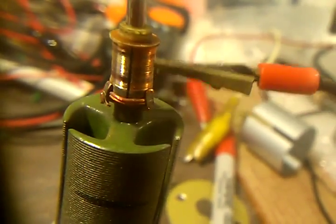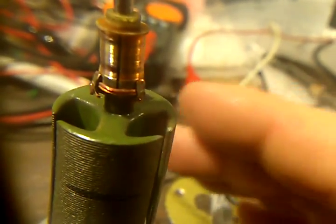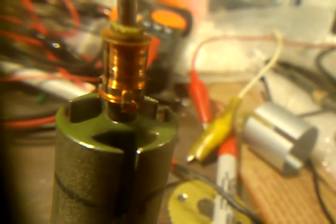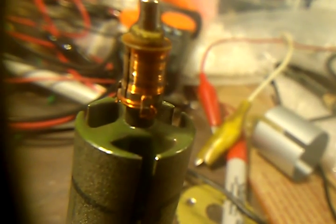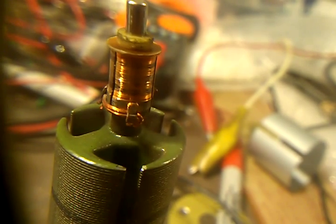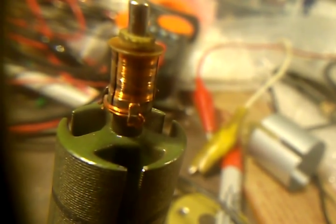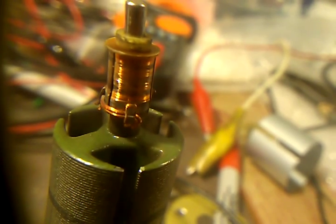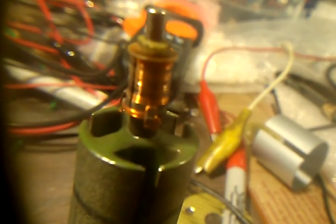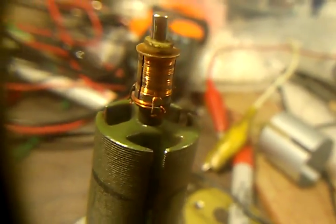This segment here has been damaged from heat just from five minutes of run time — about two amps and about 12 volts — so you really need to have a heavy duty armature. It's going to have the right copper alloy in here to handle the heat, and preferably inject some air inside here to keep this thing from burning up.